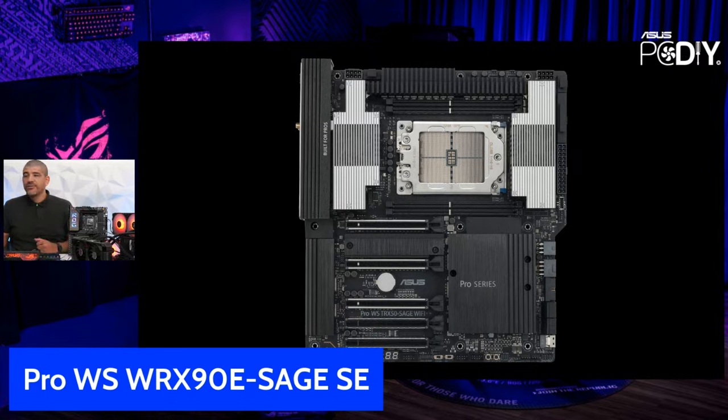In addition to that, there's also a supplemental cooling design differential, and this also makes sense because, of course, it has more PCI Express Gen 5, and so there's more active load being placed onto the PCH as well as the actual adjoining drives. So there will actually be an assist fan for the PCH and for the M.2 SSDs on the WRX90, where you actually see here this is a passive-based configuration design, okay? So that is going to be most of the key differences.